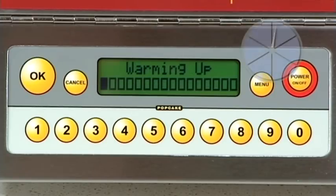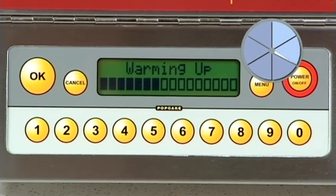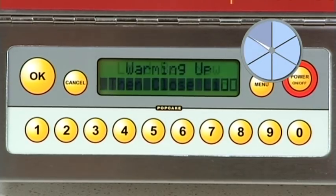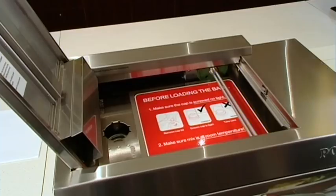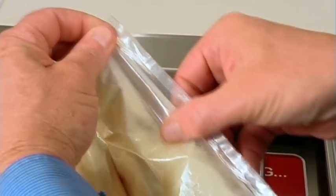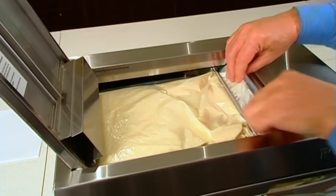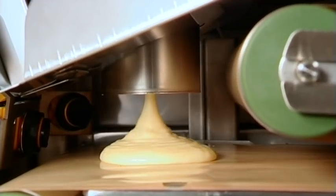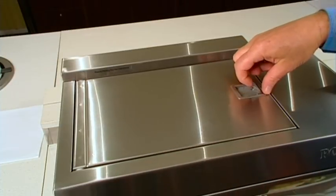When turning the machine on, it will take approximately 6 minutes to warm up. The machine will display a message to inform you when it has fully warmed up and the bag can be loaded at this time. Load the bag into the bag chamber on top of the machine. Place the cap into the hole of the splash guard. Thread the other end of the bag between the two rods located at the opposite end of the bag chamber. Make sure you squeeze the mixture away from the end of the bag to make threading easier. These rods wind the bag forward and squeeze out all the mixture. Finally, close the lid of the machine.